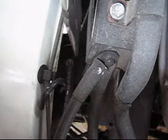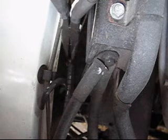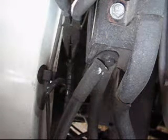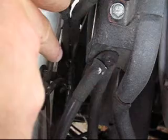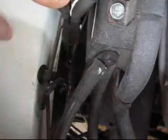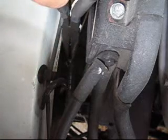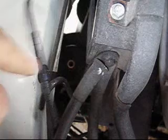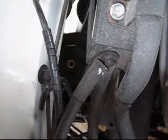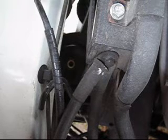If you can look at the brass collar, we're going to take pliers and gently push down on the brass collar, careful not to grip the hose. Put pressure down onto the collar on both sides. Now we're just going to pull this line with our finger — pull it out and get ready. One, two, three. And there we go. We've just released the pressure in this bag, so now the whole car is resting on the jack stand.